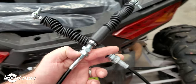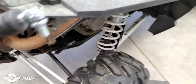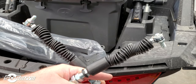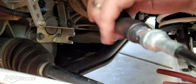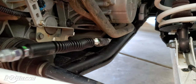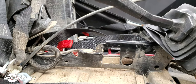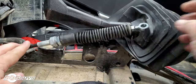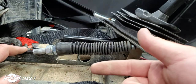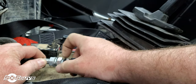A tip for replacing this cable: it's kind of hard to snake it down under the transmission, around the motor, and then up through the firewall. One thing you can do is zip-tie the end that's going up to the shifter to the back where the transmission is and just snake it through as you pull the old one out. One important thing to remember: you can easily bend that shaft, and that's actually what broke on the old one. Make sure to be gentle with it and take your time.